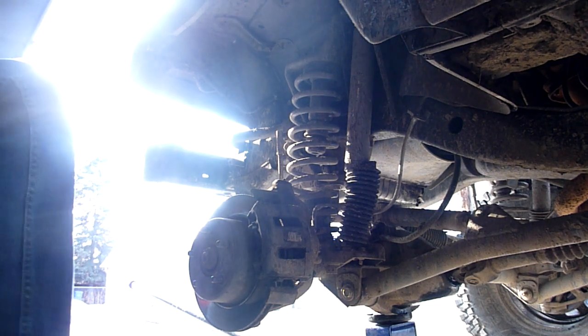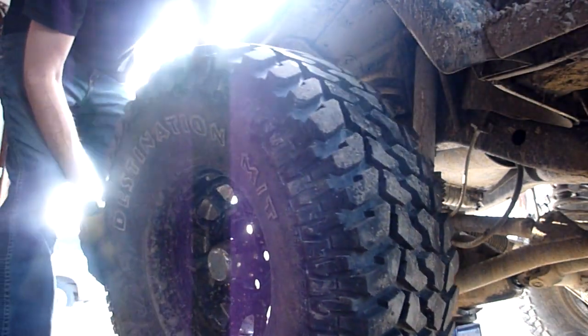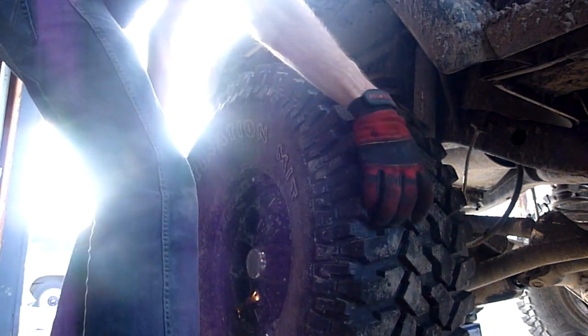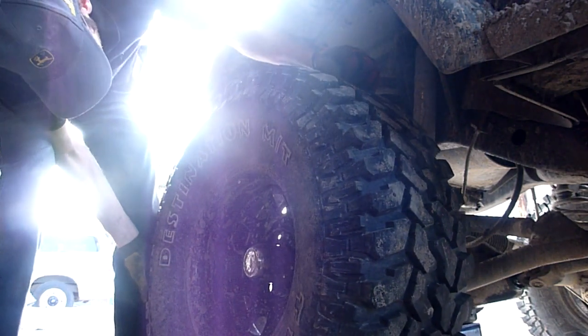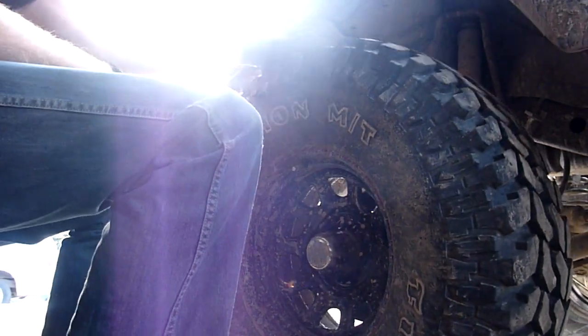Now I'm going to show you the trick of putting your tire back on. With an off-road tire like this, they can weigh up to 80 pounds or more with the rim. So rather than lifting it all the way up, we're going to get it to just the right height. I'm just spinning the tire in place to try and get our lug nut holes lined up. You can see I'm actually just sliding the tire on the ground — I'm not picking up the whole weight. Slide the bottom in first. If you have it at just the right height, you're not picking the weight of the tire off — you just kick the bottom in and let it stand up by itself.